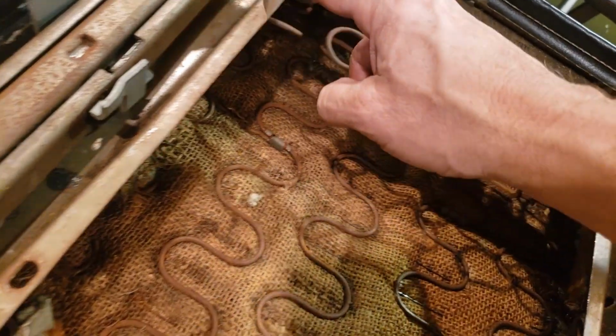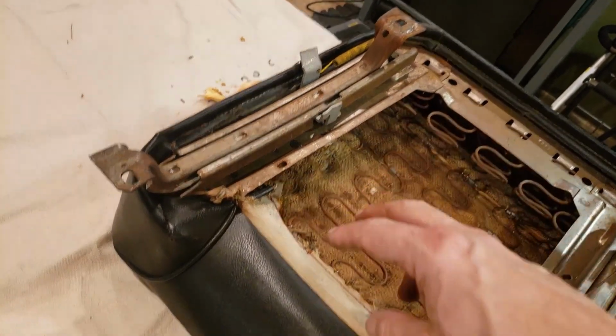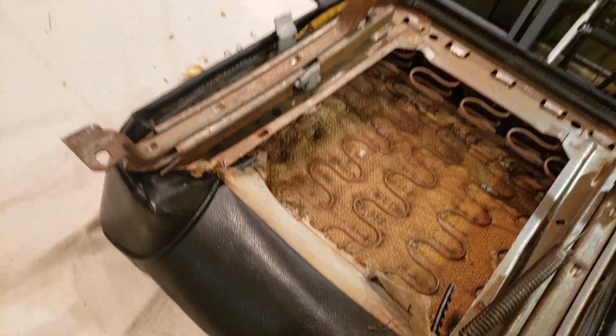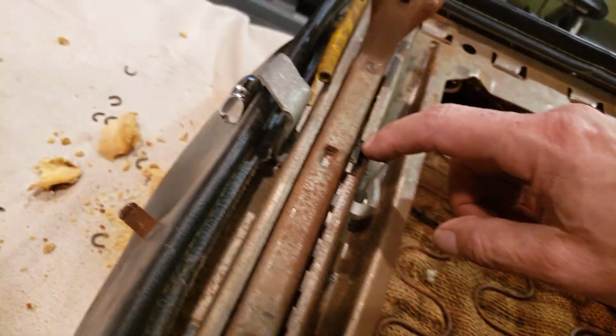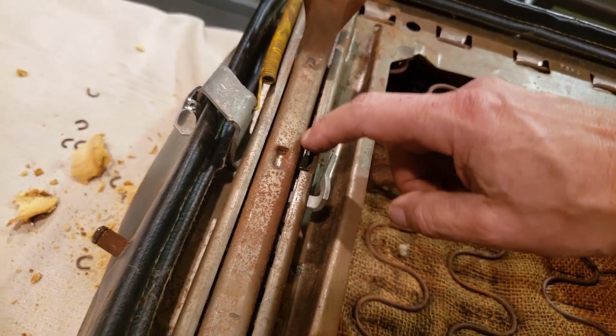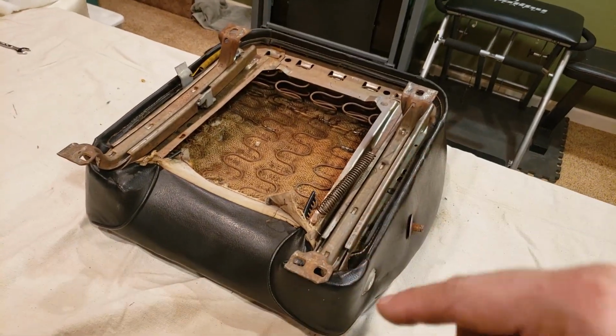What I'll have to do is, first of all, take off some bolts back here, right here, back in here, and here, and here, to take these rails off with a half inch wrench. And what I'll also do is, this side sticks. There's a bunch of oil and grease down here. It doesn't move very well at all. So I'll degrease that and re-lubricate it. So, first of all, let's get those removed.